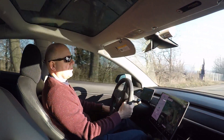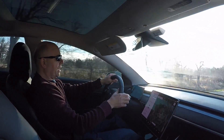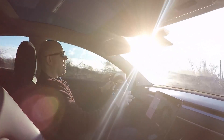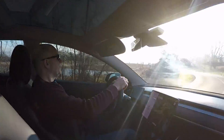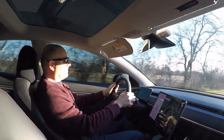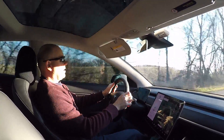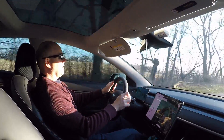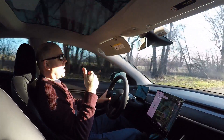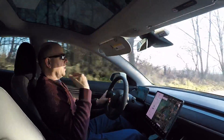Today I've got the little snowflake on the screen, so I don't have very much regen — I didn't precondition the pack before I left. So I'll speed up and then get really hard on the mechanical brake a few times. That will blow the rust off the rotor surfaces and hopefully smooth them out a bit.